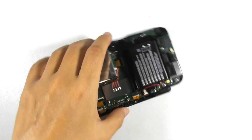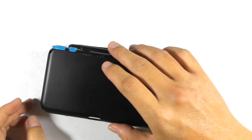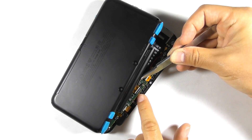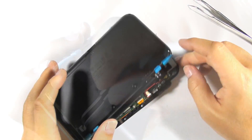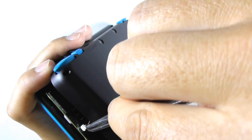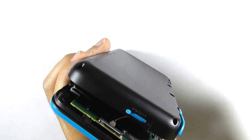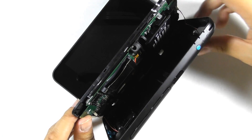Remove the SD card adapter wires from the console and start putting it back together. Use tweezers to place the flex ribbon cable to its place, then clip it back. Use the tweezer again to place the speaker header to the socket. Do the same for the opposite side. Don't forget to remove the micro SD card from the console, or else you cannot fully assemble it.